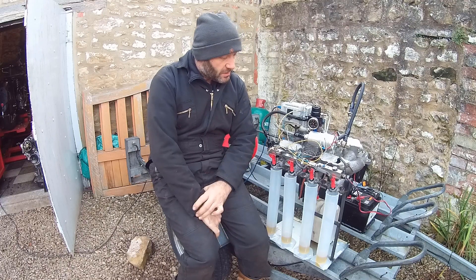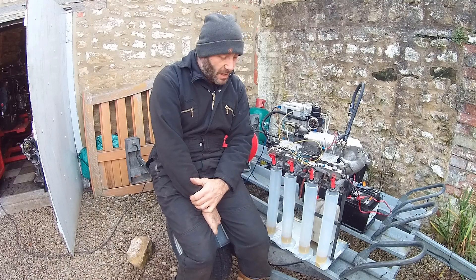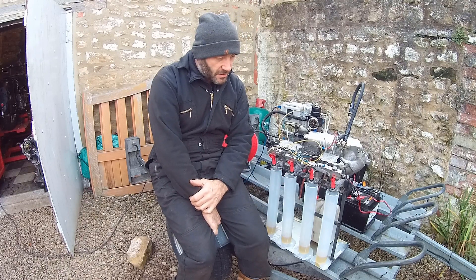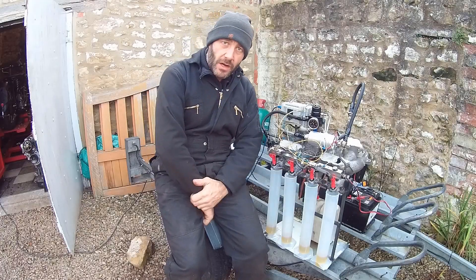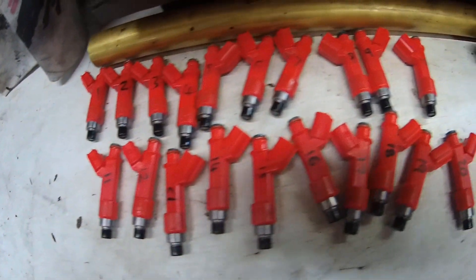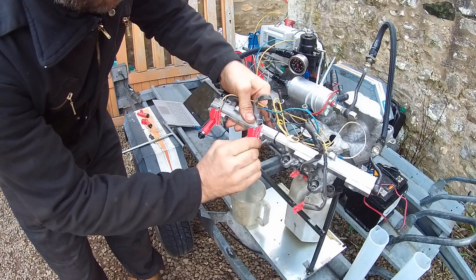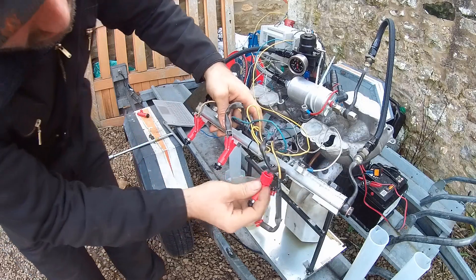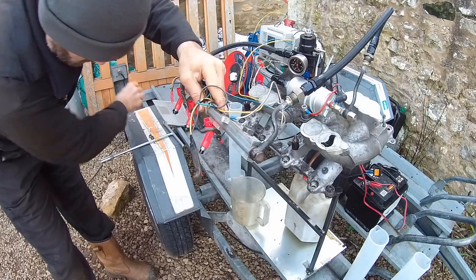We'll map it out at 2, 3, 4, 8, 12, and 18-millisecond pulses at 50 Hz, and then you get a full injector map. Cost us less than 50 quid to build. We have 20 red injectors to flow-match. The Corolla injectors we're using are actually a straight drop-in fit into the 1UZ — the only difference is they use a 1ZZ connector instead of the 1UZ connector.